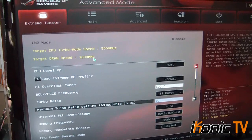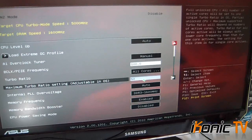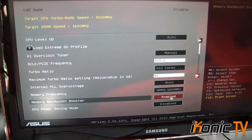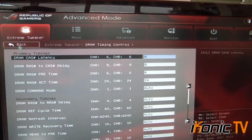What's really awesome is that with most boards before, as soon as you started to overclock the processor, you'd have to down-clock the RAM at the same time because they'd push each other. What I really love about these new boards is — I don't know how it does it — but it keeps the RAM at a solid 1600MHz regardless of whatever speed you put the processor at. These two don't correlate like they did before, which is really awesome for overclocking. The base clock stock is around 3.4GHz, so I set the multiplier to 50 to get 5GHz and set the memory to 1600MHz. I enabled the memory bandwidth booster to make sure the memory gets all the bandwidth required. I then went into timing control and set it to 6-8-6-24, because that's the timings of this memory.